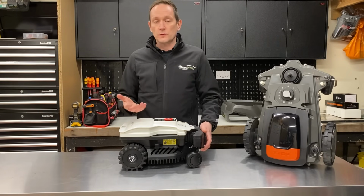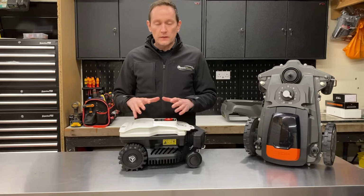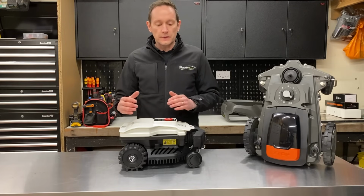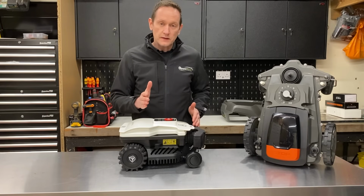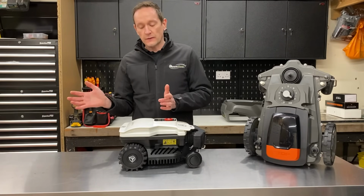They're used in conjunction with fitness apps to track the speed and movement of a person walking around. This robot has one on board, so it can compare its expected travel speed with its actual speed. So if the robot suddenly finds itself coming to a stop, even if something hasn't activated the bumper, it can use that data to make it reverse back and change direction.